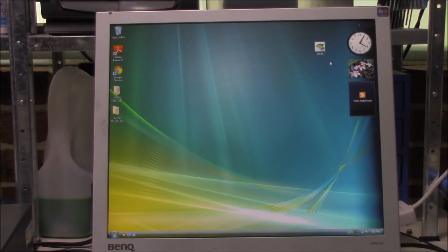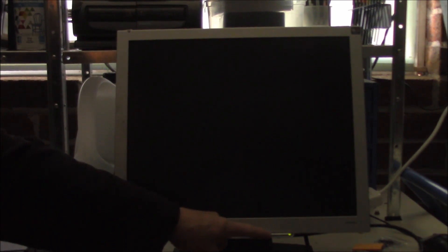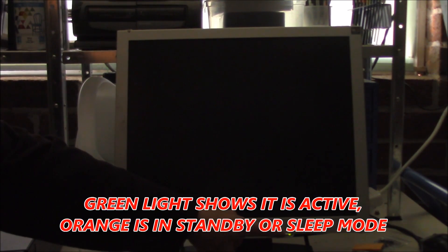As you can see, it's up and running — no problems there. But let's give it some time, let it heat up and see what happens. You can probably notice the little green button down here, so that indicates that we still have the thing turned on. It hasn't physically turned off; it's got power going to it. So to me, it's pointing to a backlight issue.